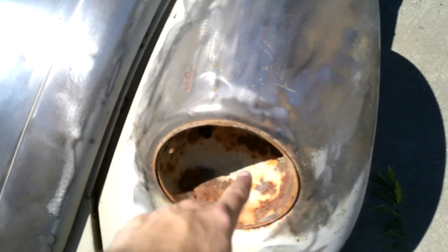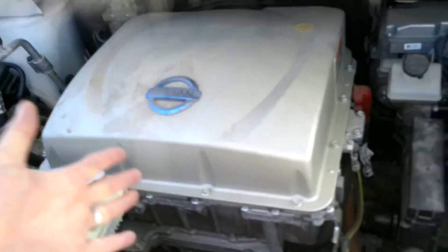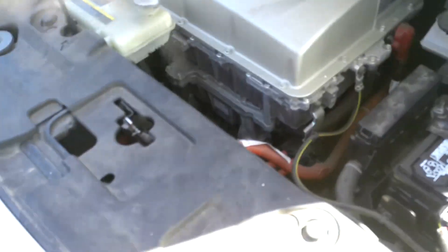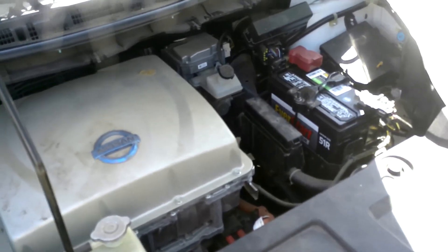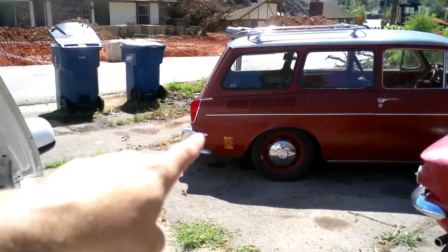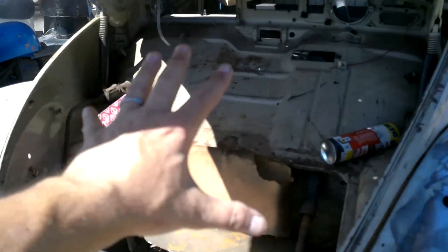Going to hide that under there. This top section comes off — it's only about eight or nine inches, maybe a full foot at the bump. Under there is the charge controller, that could be mounted in there. Don't need a fuel tank. The next part is the controller — DC to DC — does all the heavy lifting. Power brakes with ABS can be moved over, because they'll be reading drive systems from the electric motor, not from the wheel. AC system, fuse boxes. Essentially, these top two sections go away, and that bottom piece is actually slightly thinner than a 1960s-style pancake engine from a Type 3 — and definitely thinner than a Corvair.